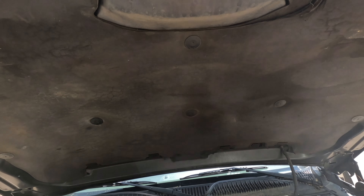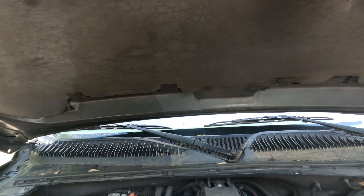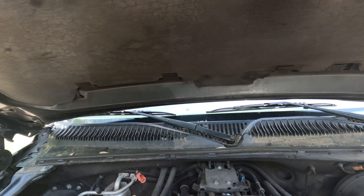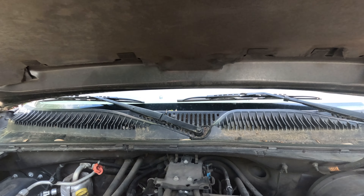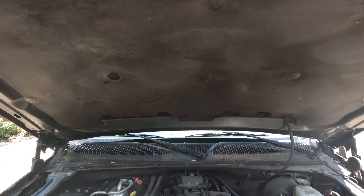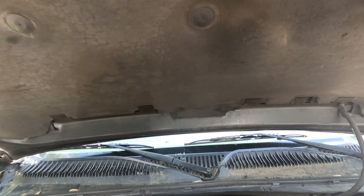First, you're going to take this cover off — there's going to be an engine cover that pulls off right there, and then there's going to be a little plastic screw cap right here. You're going to undo that, and all you're going to need is one other person and a screwdriver. Just stick the screwdriver in, then turn the car over. As you can see, no fuel came out, so you know fuel is not actually getting to the fuel rail from the engine.